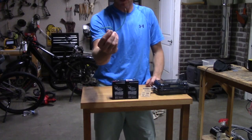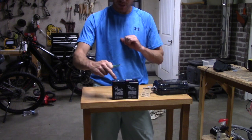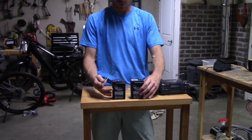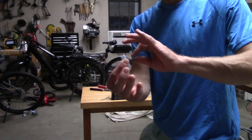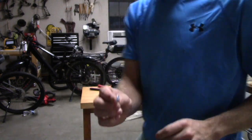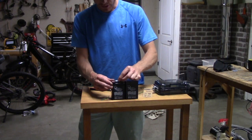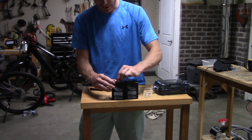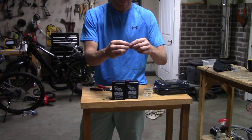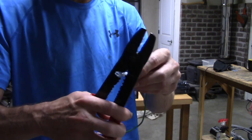So the next thing you're going to need is a piece of wire. Right here I've got a piece of 12-gauge wire, which we're going to use to connect the positive terminal of this battery to the negative terminal of this battery to create 12 volts from two 6-volt batteries. These little quick connects that you can pick up at an automotive store are going to be what you'll need to connect to the prongs on these batteries. They're just going to slip right on just like that. We're going to take these and crimp them on the end of our 12-gauge wire by sliding this on and then just squeezing.